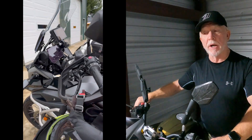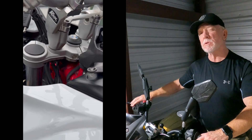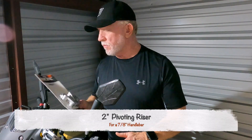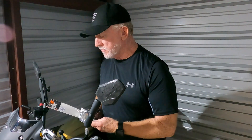The first thing we opted for was ROX risers on our bikes, and we are in love with them. They just give you a sense of control and they're much more comfortable than the standard ergonomics that the bikes are set up with. So the first thing we opted for when we decided to get these bikes set up is we made a quick phone call to ROX Speed FX in Minnesota and the team there got right on it. What we have is a two-inch ROX riser, which for the 7/8-inch bar on this bike is what we're going to install today.